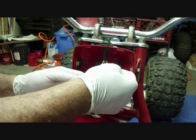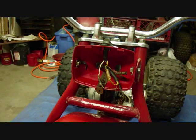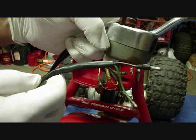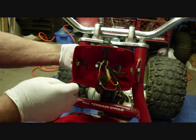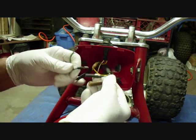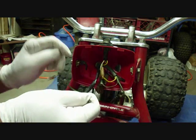There's also a blue and a white wire that'll go into the light bulb. Now we're ready for the ignition switch or kill button. It's attached here, and there's a green and a black wire coming out of it. We'll feed that through the hole in the back of the frame and attach it to the green and black wire coming out of the wiring harness. The other end will be attached to the handlebars.